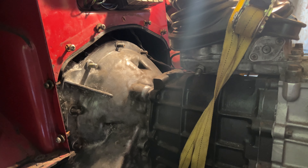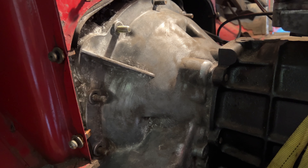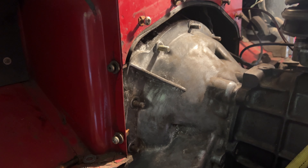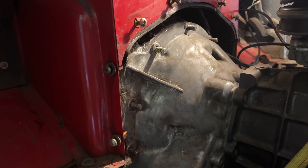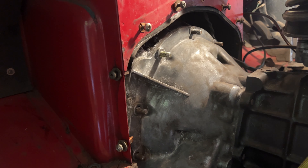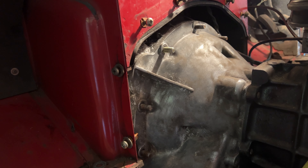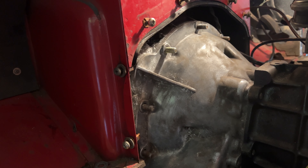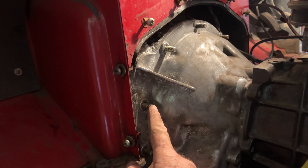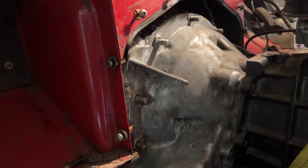Finally — three hours just to line that up, which was rather difficult. I do have a little confession to make: I bought new studs to put in, and in the actual casing there are more thread holes than holes in the casing. I had one extra stud in at the bottom which I couldn't see, so it was never going to go on. After taking that out, it only took 10 minutes to line it up. So here's a little lesson — if you're putting one of these on, there's an extra thread hole in the engine mount casing: don't put a stud in it.